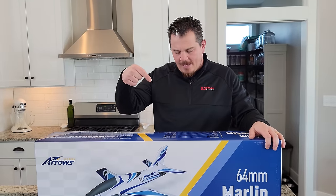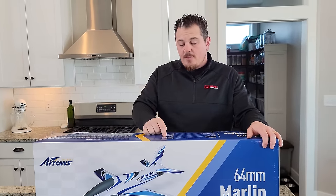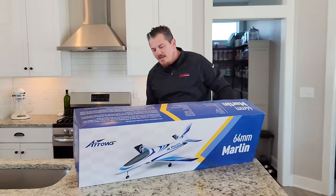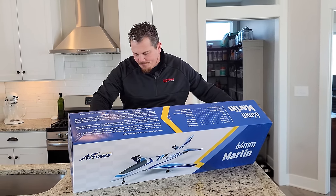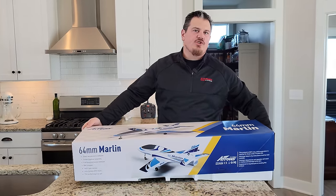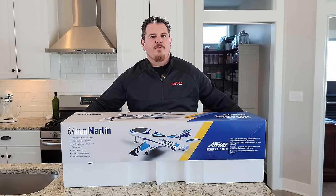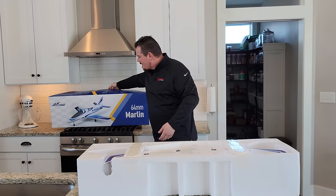So if it is running at 4S, that would be like 20 volts. So 20 times 3,150 is the RPMs. That's a lot. Yeah, it's a lot of RPMs. That's crazy. So in an EDF, it's always about speed and movement. On a bigger prop, it's really hard to get up to speed because there's so much torque requirement, and you create a huge current load when you first start them. So that's why you run an EDF really fast.